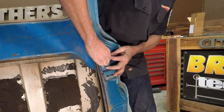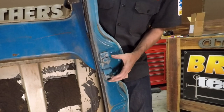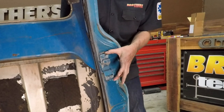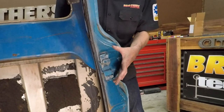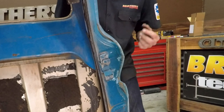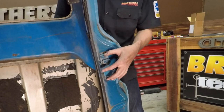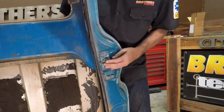Notice there's quite a bit of movement in this — it comes way up, way down, to the outside, to the inside. If you don't have that range of movement, it's probably because the factory put a lot of gunk in the back to hold it and keep out moisture, but that dries up and solidifies over time, or the caged nuts are rusted and won't allow movement. Just shoot some oil in there, get it cleaned up, and make sure you have good movement.